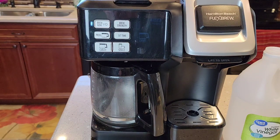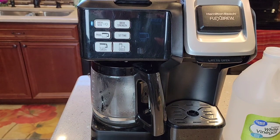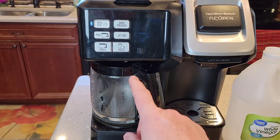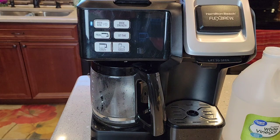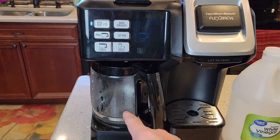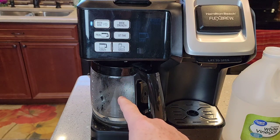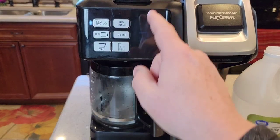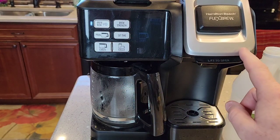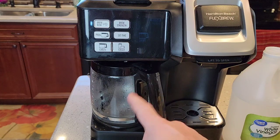You'll know it's done when the coffee maker stops that percolating sound. To do both sides, you're going to have to give yourself about an hour, hour and a half. But it does get to sit for 30 minutes. When we're rinsing this side, we can have the other side soaking. The vinegar is going to come through here — we're going to dump that vinegar out, rinse this out with soap and water, then put fresh water in and run the fresh water through. And we'll put one cup of vinegar over here and have that soaking while we're rinsing this side.